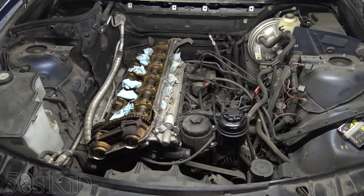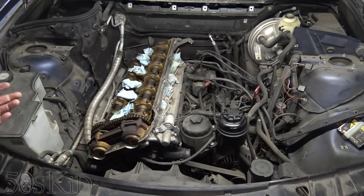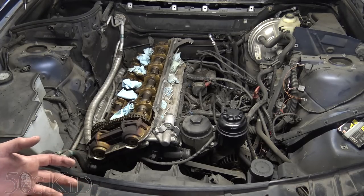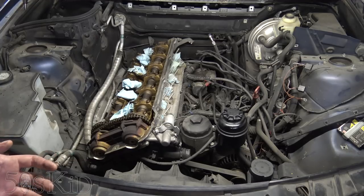I'm not going to have him do a valve job because I don't really think there's much of a point, unless something happened like a burnt valve. It's all going to depend on what the damage was. If I'm assuming this car overheated and the valves are fine, I'll figure that out once I take it off. I'm not going to pay for a valve job unless something went particularly wrong. I'm obviously not going to take the whole block out like I did on my rebuild — that's just way too much work. It's just a head gasket.